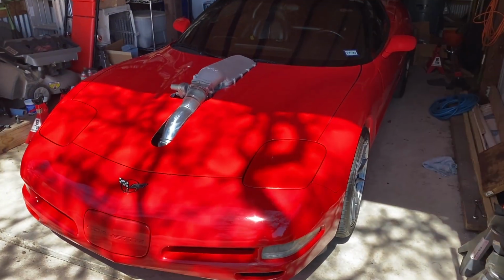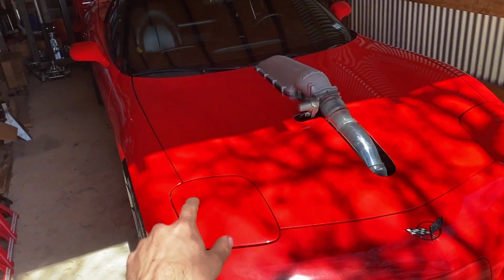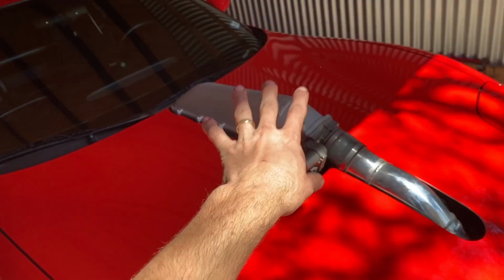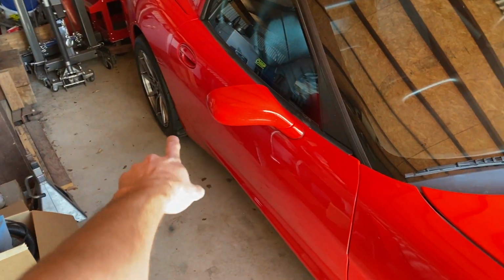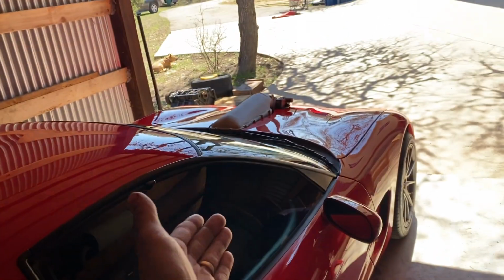All right, everybody. C5 is all prettied up for the mile. The only other thing we need to change, Josh, the shop owner where I dyno this car at, mentioned that, because right now I have the catch can in the front, and now the timing cover's fixed, the oil spraying issue was also fixed. However, he mentioned that if during the run something goes wrong in the engine and that catch can fills up with oil, because it's in the front of the car, all that oil is going to go underneath it and could potentially get under the tires. So he recommended me to move it back up under the bumper right here on the rear quarter panel, so that way if worst case scenario something happens, that fills up with oil, it sprays oil behind me, keeping the tires clean. So I ordered a whole bunch of hose and fittings to relocate it, and so that stuff will come in next Tuesday. It's Saturday right now, and once that comes in, we're ready for the mile.